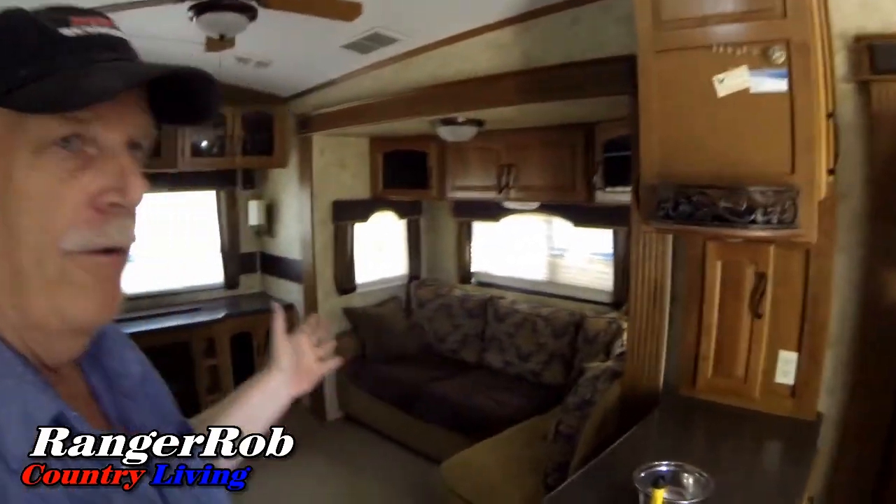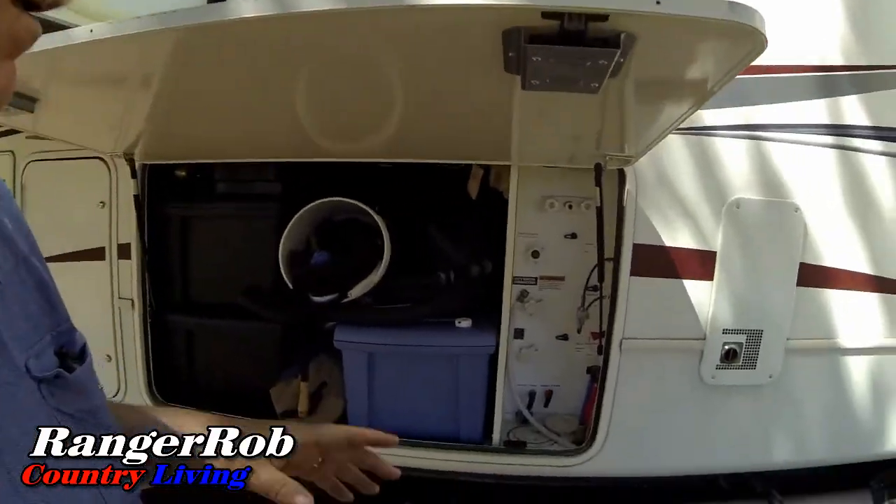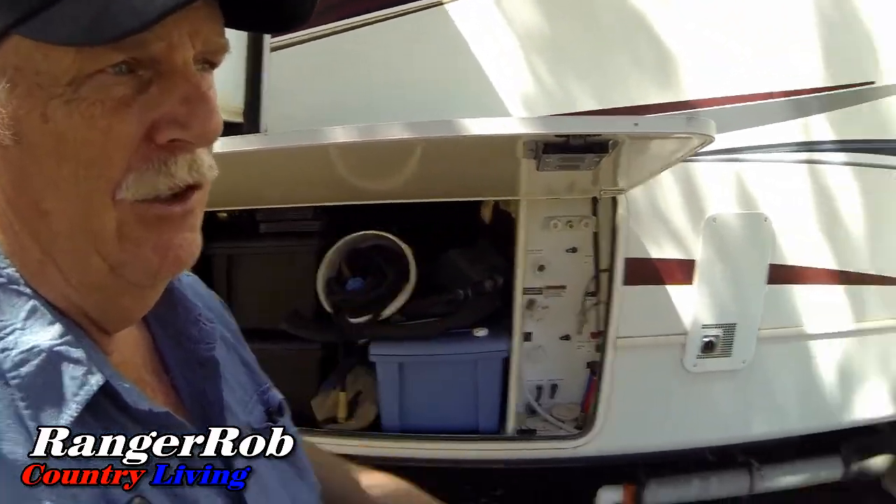As you can see, this becomes a very roomy RV — a nice big living room, entertainment system, nice little kitchen, king-size bed, shower, and all that good stuff. We've loved this thing and lived in it full time before — very comfortable. The Montanas have a very nice winterizing system; it bypasses the hot water tank when you drain it. So what we're doing is turning on all the systems so everything works again and getting a little bleach into the system to sterilize all the pipes.